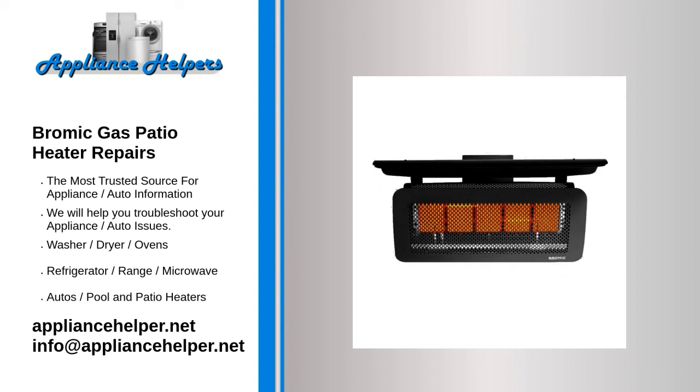Starting issues or reduced heat production. Outdoor furniture and fixtures accumulate dust, dirt, and debris. When these elements stack up on a patio heater's gas or electric heating element, the heater may have starting issues or reduced heat production. If your patio heater has these issues, cleaning it could be all you need to do. To clean the burner or heating elements, remove the emitter screen to expose the burner or element. Because these should be kept dry, use compressed air to blow off dust and dirt instead of a damp cloth, then reattach the screen.